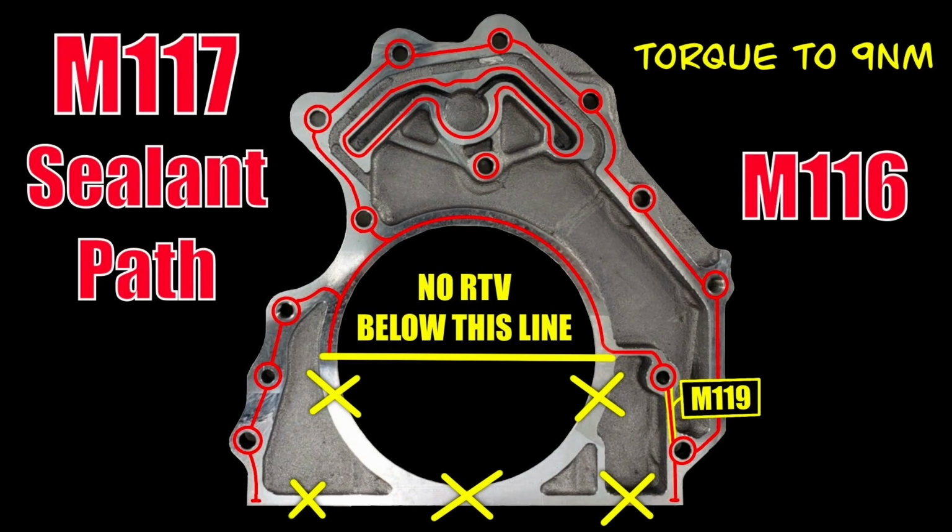This is the sealant path for the M116, M117, and highlighted over there is the M119. You would leave that without RTV right there. Now, you don't have to go around all these holes like this. You do need to go around the hole there at the top. You need to go around this hole over here by the M119, and you might as well go around that one below it as well. But other than that, you don't need to go around all those other ones because your sealing is what? Nothing. So you really just need to go on the inside all the way through that. And that's probably what I'm going to do.